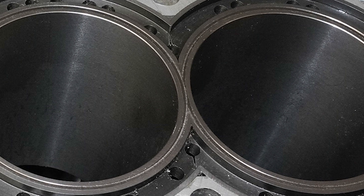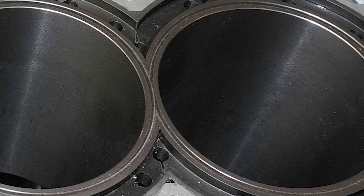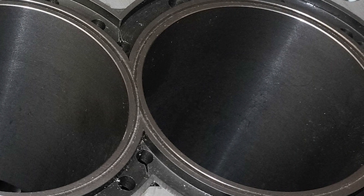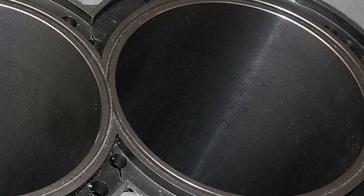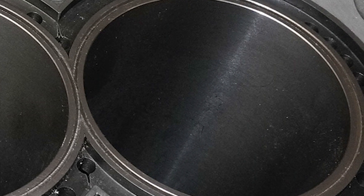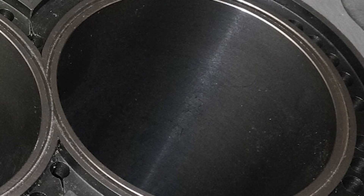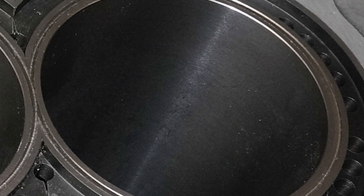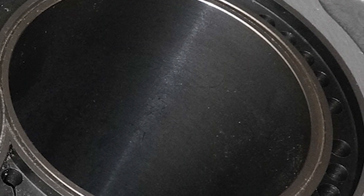He also step decked the block and cylinder sleeves. What that means is the cylinder sleeves are actually slightly higher - by a couple thousandths of an inch or so - than the outside aluminum of the block. That allows the clamping force to be focused on the sealing surface of the cylinders, which will keep the combustion gases in the cylinder so they don't leak out.